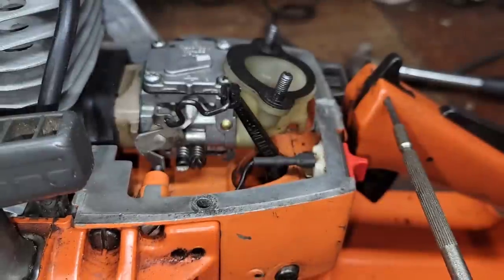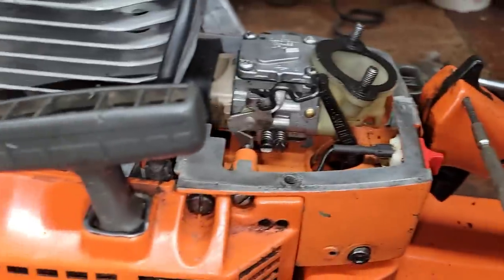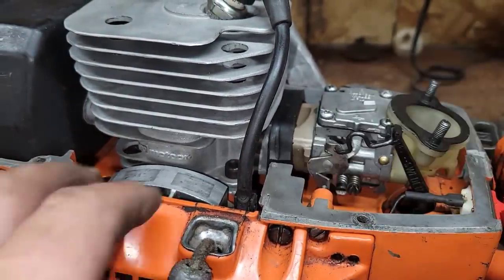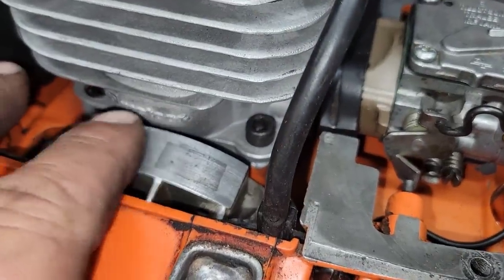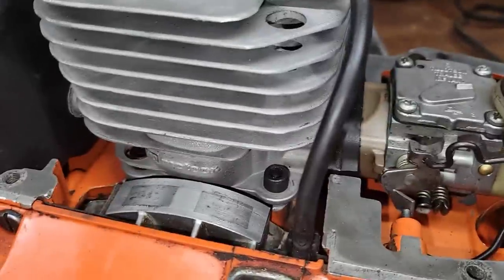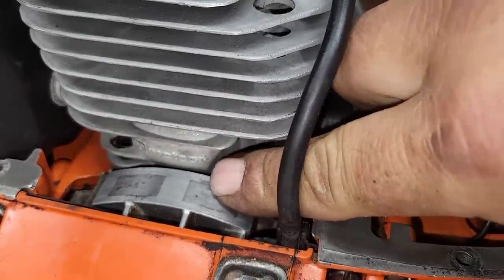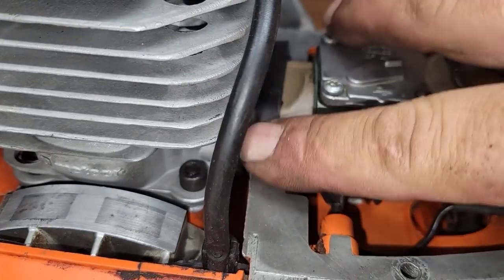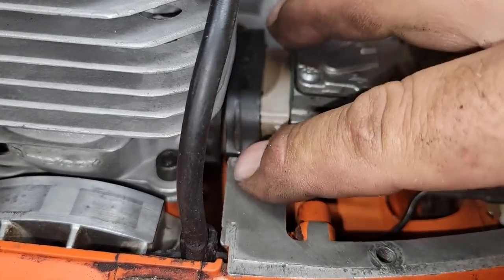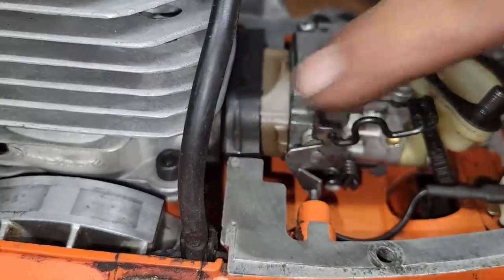And again, friends, if you're going to jack the compression on these and lower the cylinder, right? Think about it. So when you drop this cylinder, okay, friends, look how close that is to the flywheel. If I went another, you know, 50 thousandths more, say, and you could, there's plenty of meat there and enough intake timing to do it, you're going to start rubbing the flywheel. Also, this piece is not going to fit anymore. It's going to be too loose, or too tight, and you're going to have to grind that bottom groove, and then this piece doesn't fit. So now you're sucking hot air